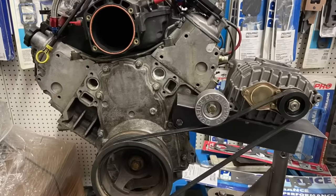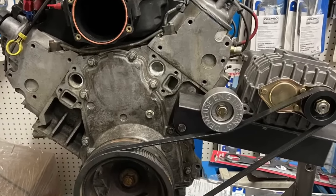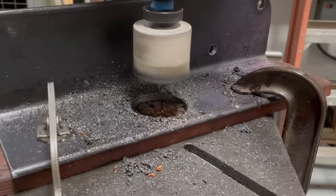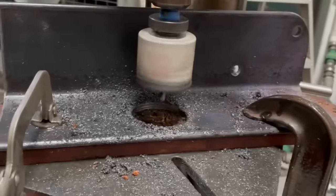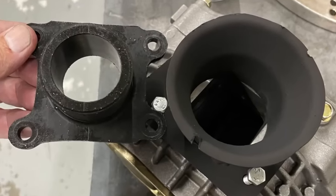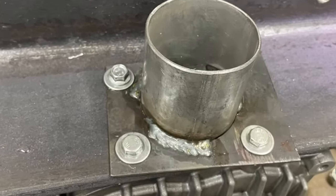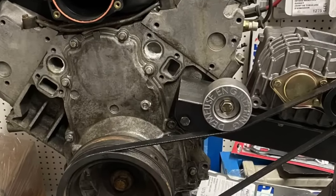Supercharger. In order to flow test the AMR500 supercharger, the first thing I had to do was build a bracket to mount the supercharger on the LS motor. Use a hole saw to cut this thing up. You want to make the opening bigger than that. I also welded up a larger inlet and outlet for the AMR500 supercharger to improve the airflow. Once I installed the tensioner with the right size belt, we were ready to test.